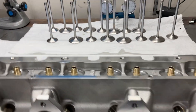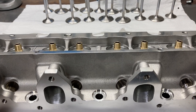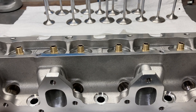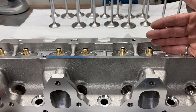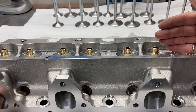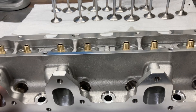I can get about 540 horsepower from a 390 — not stroked — on pump gas with a fairly thumpy hydraulic roller and a dual plane intake. These cylinder heads on a 465 will make almost 700 horsepower in a bracket race or road race situation.